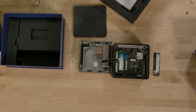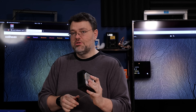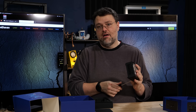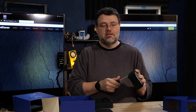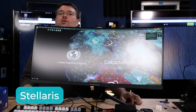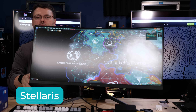If you're going to DIY this, I'd recommend getting SATA for bulk storage. This really isn't going to make a gaming machine, but you can stream with it and it would be a great home theater PC — maybe a little overkill; you don't even need an i5 for that. But because it has pretty reasonable integrated Intel XE graphics, you'd be able to do good game streaming from a more capable gaming machine, and games like Stellaris and Cosmeteer will run pretty much okay on Intel XE.